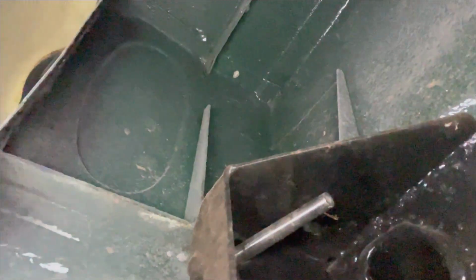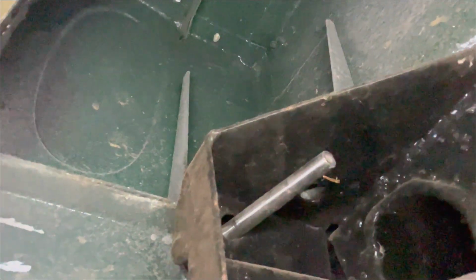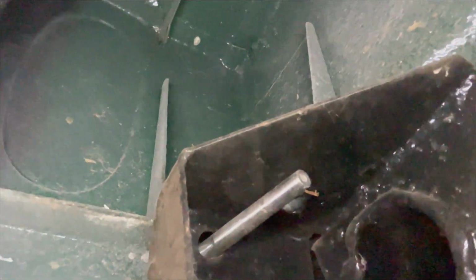This hole here at the rear is where the bumper bracket bolt comes through and hooks up through the frame. You can see the hole there in the frame, so that's another location that needs to be aligned. Here's a better representation of how that bumper bolt goes through the frame. I've just stuck a pin through, and you can see where that comes through the body tub and hooks up through the frame at the rear. That's really important to get aligned, otherwise you'll be in trouble when it comes to mounting the rear bumper overriders.